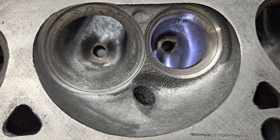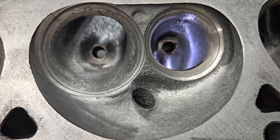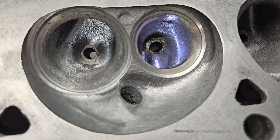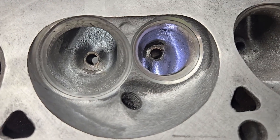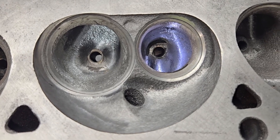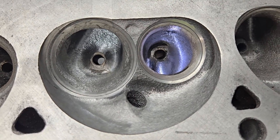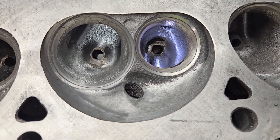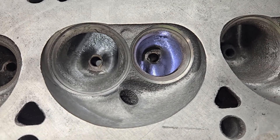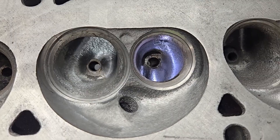These are GT43 bar heads — nice heavy castings, they weigh like 50 plus pounds each. There is quite a bit of metal on them. You could probably take a hundred thousandths off pretty much everywhere and not really worry. Of course the sonic gives you a better chance of not making them sprinklers, but you can get quite a bit done if you take a hundred thousandths off, and even better if you know where to take it off.